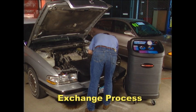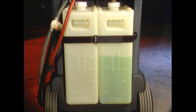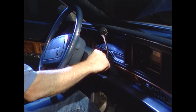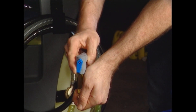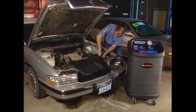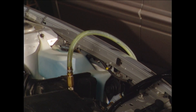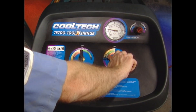Before starting the service procedure, verify the following: the 75700 unit is connected to a supply tank holding the correct amount and type of new coolant for the vehicle being serviced; the waste coolant tank has enough capacity for the desired exchange — running the unit with a full waste tank will disable the ability to pull vacuum; the vehicle's ignition is in the off position; valves one and two on the 75700 are off; the valve on the black hose is open; and the filter screen on the clear hose is clean. After the hoses are connected correctly, all the technician has to do is select the mode of operation. During the exchange process, the tech can observe the supply tank and the waste line. When the predetermined amount of coolant is exchanged and the color of the coolant in the waste line matches that of the new coolant, the technician can stop the exchange by positioning valves one and two to the off position.